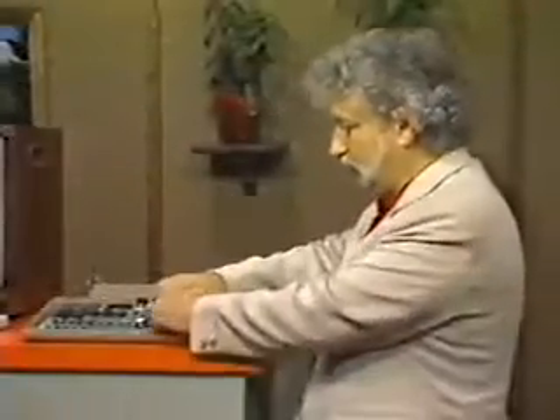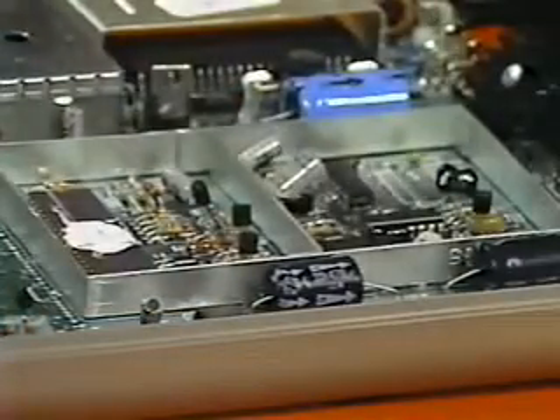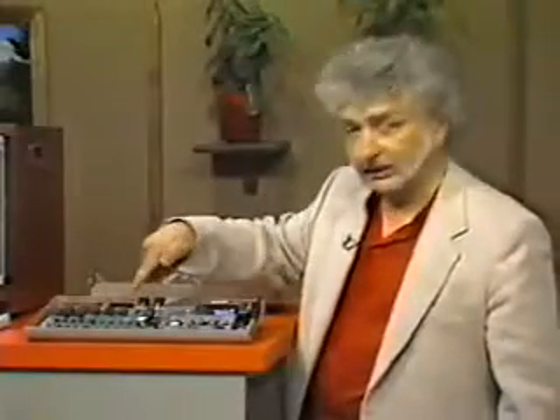And finally, inside this can, we have circuitry. You should never open this one up, especially if you have a plan to play the concert piano. Inside, what we'll see — with a little bit of heat-sealed gunk on it — is a video chip that actually makes a signal that goes to your television set or your monitor. If it goes to the television set, it goes through what's called a modulator in here. But that's really about it. The other little chips in there are just used to connect the pieces together logically.